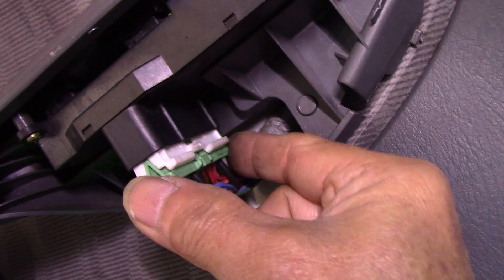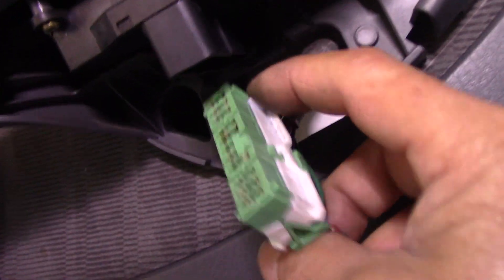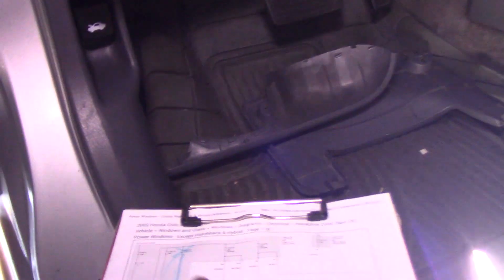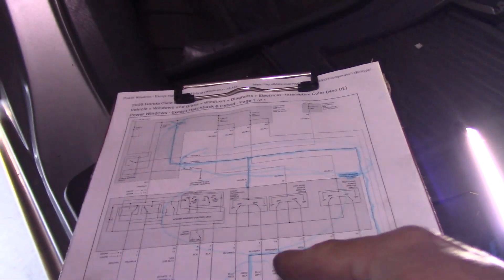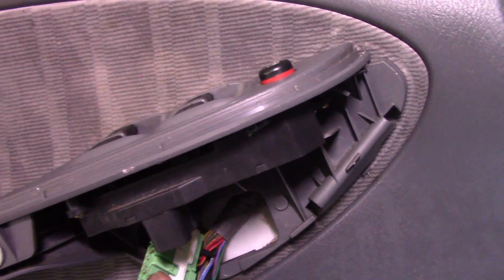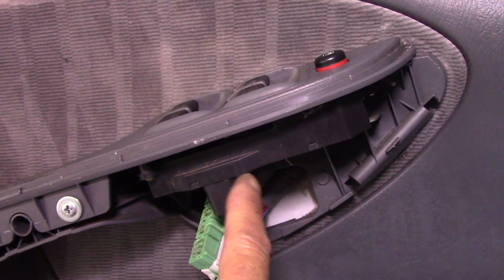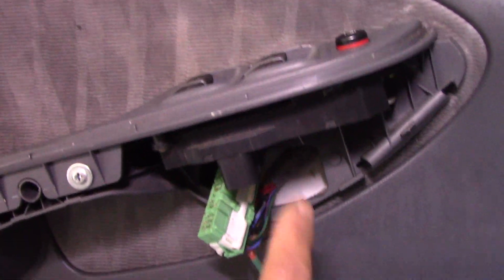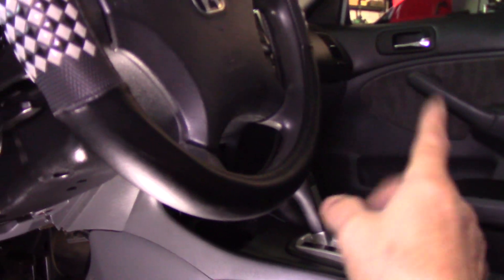See? I put it back - we have the ground. Lucky for the vehicle owner - we don't have the short on the wire, because this wire runs around inside under the dashboard, inside the fuse box. But we don't have the ground right here when I disconnect this - that means all the wiring around here is okay, into the passenger switch out there is okay. Everything is okay. And now why do we have the ground here every time we push it in? I believe the master switch is bad - it's short inside the master switch.